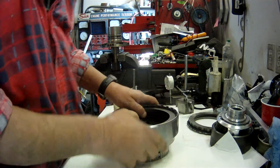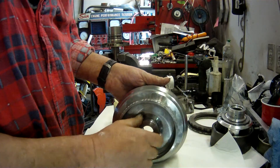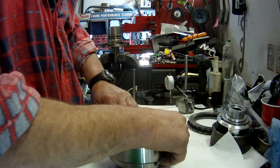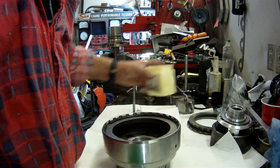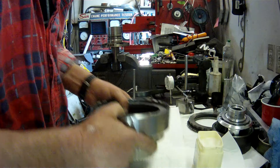These clutches — all the clutches are dry. For when I'm pressure checking, I use the cast iron factory sealing rings. Because the Teflon ones — to get them to sit right, you fill the grooves full of Vaseline and you squeeze them in there. They'll stay stuck in so you don't nick them when you're assembling the transmission.